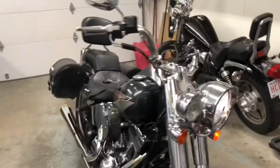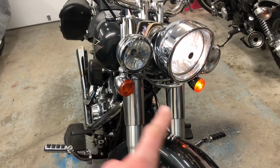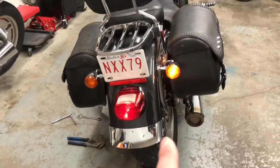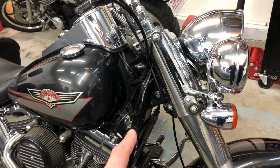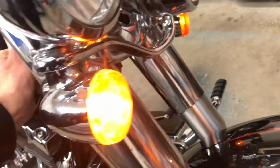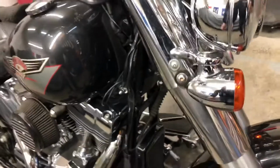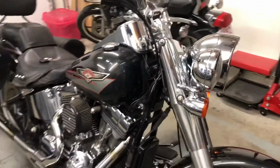Next on the list is his front right turn signal. The driving light portion doesn't work, as you can see. And also, I've got the turn signal on right now and it does not blink, yet the rear one does, but really, really fast. My guess is it's just a weird electrical issue, because if you squish the harness right in here, you can get it to light up as well, but it's still really, really fast. So my guess is bad power connection, probably bad ground as well. But yeah, let's rip into that.